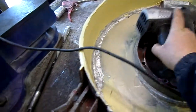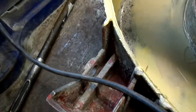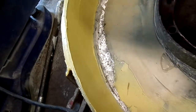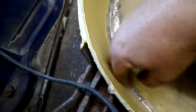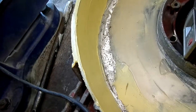Any filler that's damp, you've got to dry it out and really get a good dry in. What happens with filler is it'll absorb water and go straight under, it's porous. So you've got to really dry it out, and dry the steel or aluminium, whatever your filler's on. You want to make sure you get the heat through it and dry it all out, especially if you're doing any priming over the top.